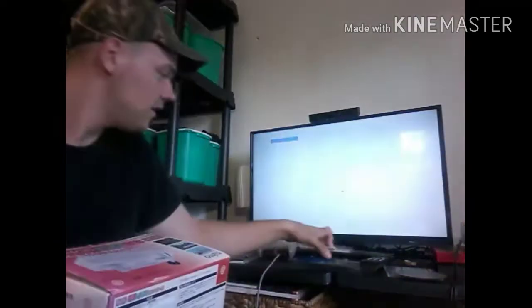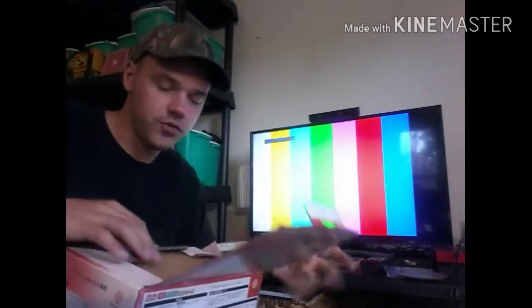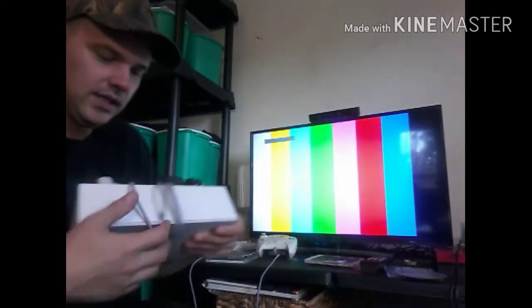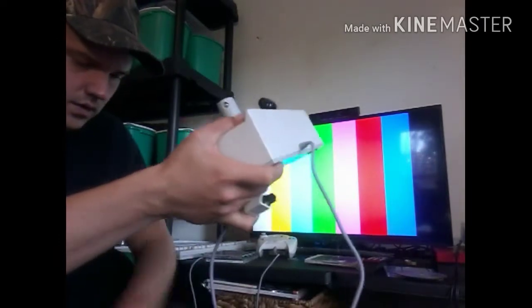It's a train simulator — do you want to be a conductor? I do. Never put your controllers in while the system is on because you can pop a controller port. Don't pop your controller ports — it's an easy fix, but it could frustrate a lot of people and they might throw away their Dreamcasts. They just pop the controller port; you just have to twist a diode. It's a very simple fix. The Dreamcast is very wonderful when it comes to being fixable.